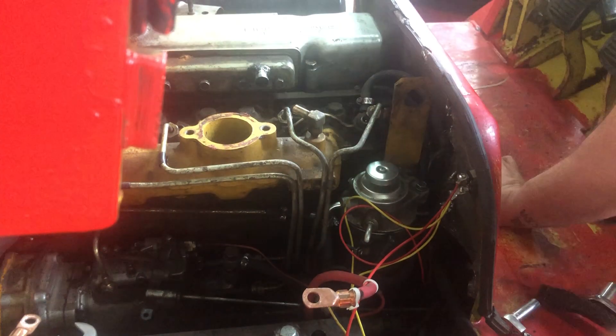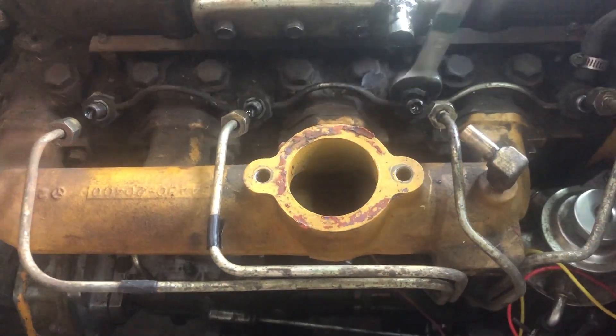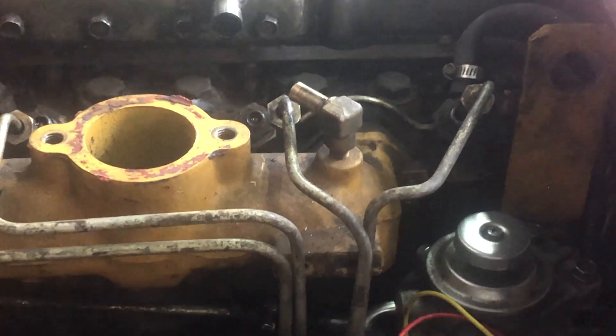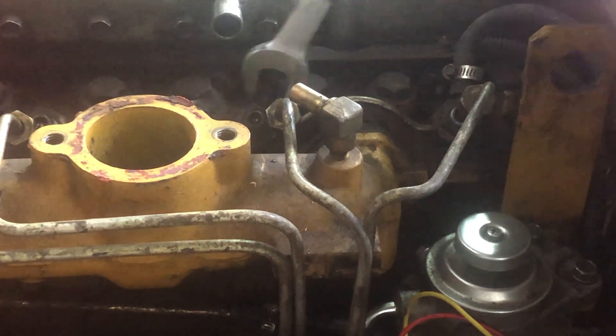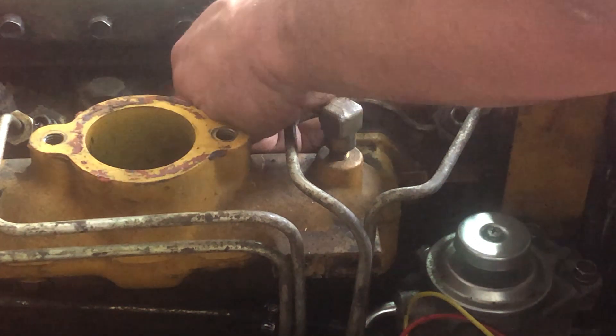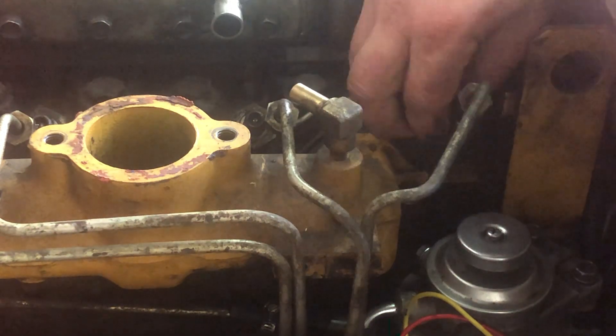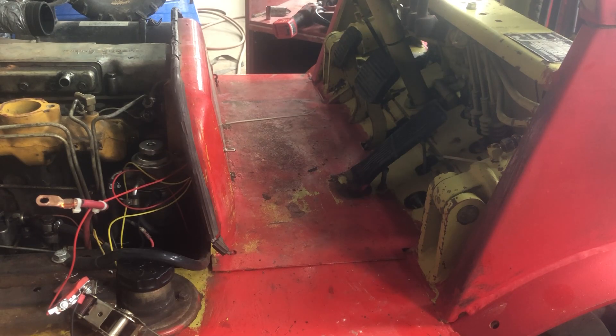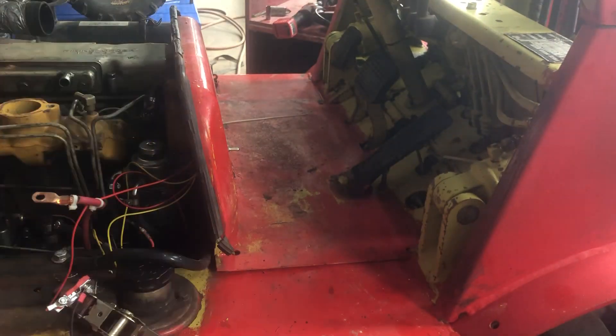Notice that the injector stays on the side of the intake manifold are not in place anymore — I never put them back. There's a set of nuts here that goes over this fuel transfer bar. You've got to pull them off all at the same time; you can't pull one off and then pull part of the fuel transfer bar.